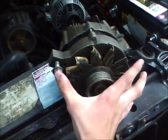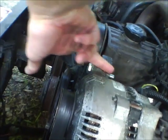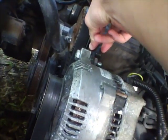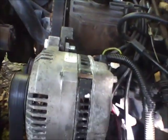The distance between the two mounting bolts is the same, so it should fit. You will probably need to get a bolt that will fit through this unthreaded mounting bracket and the original mounting bracket on your Ford, because the mounting bracket on the engine is not threaded and neither is the hole in the alternator — but the second gen's is threaded, as you can see. I recommend using a locking washer and a nylon threaded nut to keep the whole piece from vibrating loose and having the alternator come off.